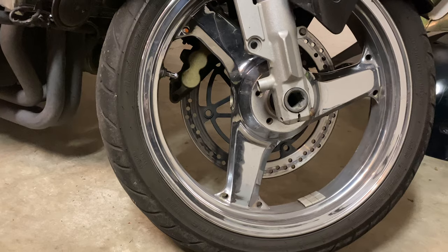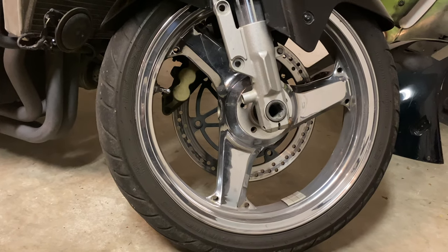Also, actually lightening the bike and getting rid of all the unnecessary pieces that add up to weight. Power to weight ratio is very important. A new Gixxer 1000, a new ZX10 can easily make what my ZX1200 makes and be lighter at the same time. So for instance, my ZX12 only has one front rotor. I could delete the rear brake. I can get rid of the passenger pegs. I'm actually gonna go sidewinder exhaust, so I'm not gonna need either one of the passenger pegs.